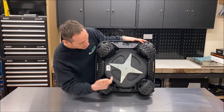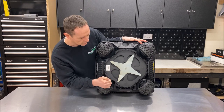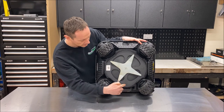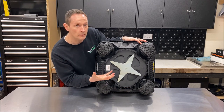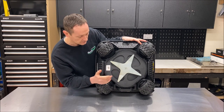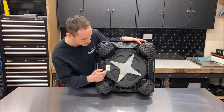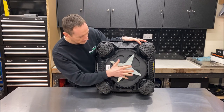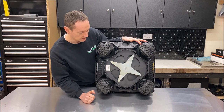Underneath here you'll see there's a 29cm four-knife blade, sharpened on both sides, and it's surrounded by a blade guard with rubber flaps on top to prevent build-up of mulch sticking to the underside of the robot. The flap can flex and move, allowing it to shake off any build-up, whilst a comb arrangement allows grass to pass through. The blade itself is motorised so the whole unit can move up and down to change the height of cut.